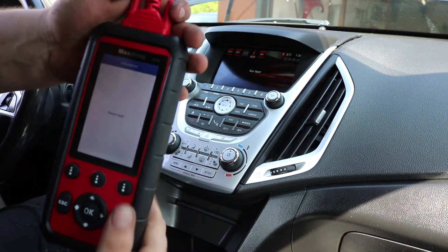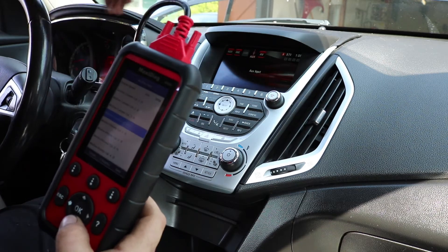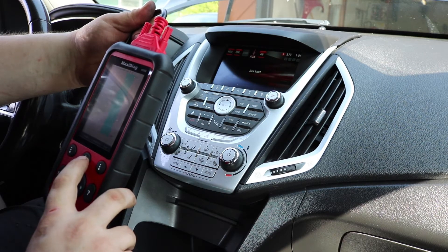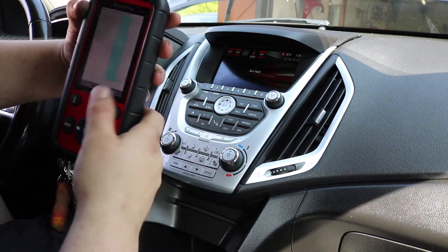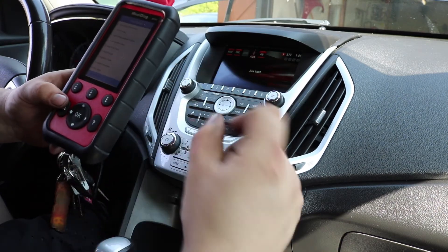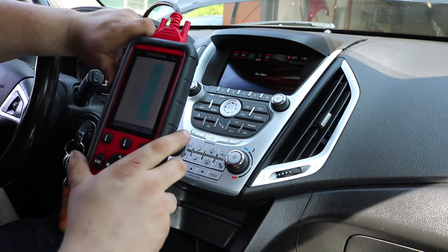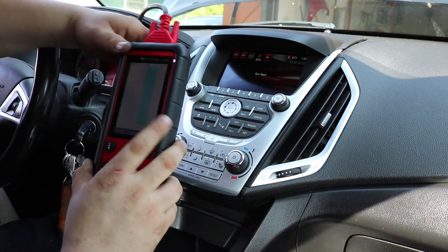For what people might call a pocket scan tool, this thing has professional-grade standards — I'm very impressed. It gives me current misfire counts, and you can actually graph it. For example, misfire cylinder 3 — you can watch the graph scroll across in real time. Right now it's at zero. As you're driving, if it is misfiring on that cylinder it will graph it, so you're not just watching a number go up and down — you can actually see fluctuations.